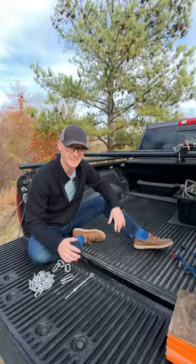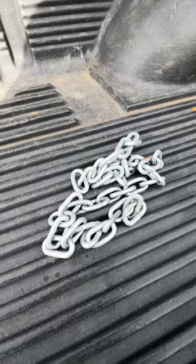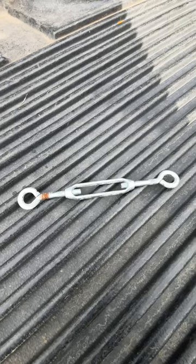Could you use a way to add over 80 tie-downs to your truck bed or trailer in under five minutes? You're going to need a length of chain long enough to span from one tie-down point to the other. You're also going to need three connection points — I chose quick links, but you could also use carabiners. And the final piece you're going to need is a turnbuckle.